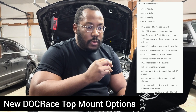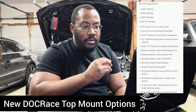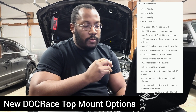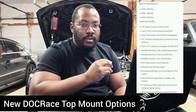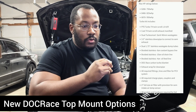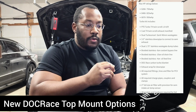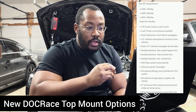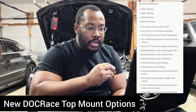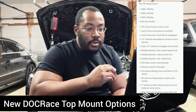The kit also shows what it comes with. You get the actual turbo itself, a cast T4 manifold — and just as a reminder, he's only offering cast manifolds now. They are higher flowing, so they improve spool and overall performance. It doesn't look as cool as a welded tubular manifold, but it will really perform. It also comes with dual 40mm wastegates, a stainless downpipe, and two wastegate dump pipes. Since this kit uses a Precision turbo, it doesn't need coolant lines like stock turbos, so it just has a coolant bypass line bridging the inlet and outlet from the block, plus the oil feed and oil drain lines you'll need.